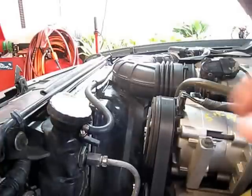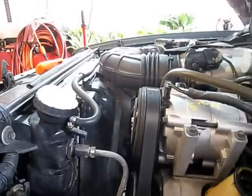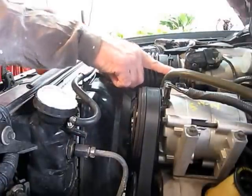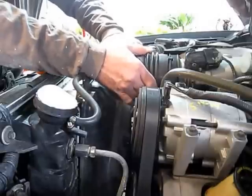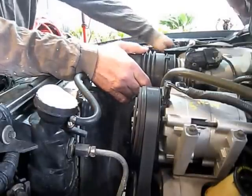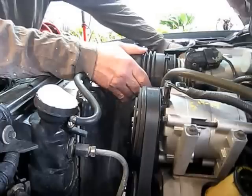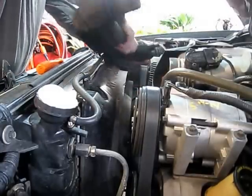I'm going to start removing a few things, starting with my air intake pipe. We've loosened off this screw and this one right here. This is going to be a little difficult sometimes to get off, but just keep giving it a little wiggle. If you have any sensors connected or hoses, you can unhook those before you get this too far — you don't want to snap anything off.